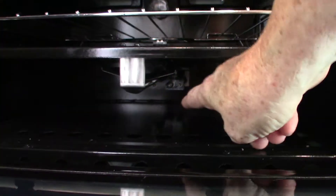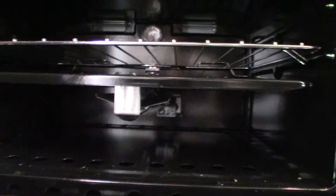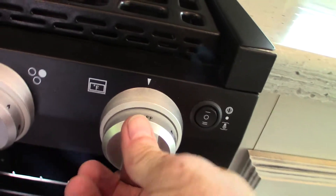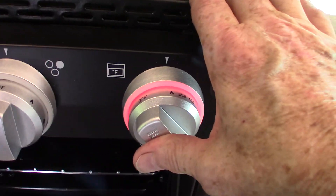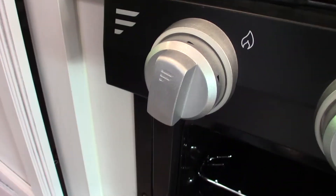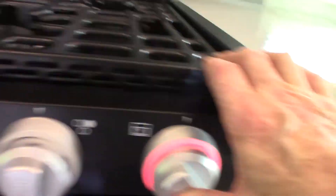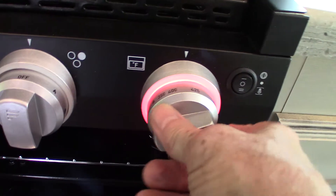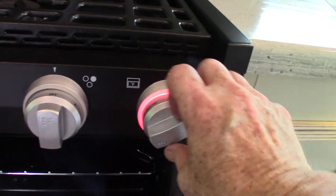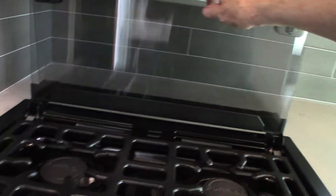The oven is a little different. All the way at the bottom, all the way to the back, is a pilot light. What you're going to do is go to the oven knob, go to the picture of the flame which means pilot light, and depress it. Keep it depressed during the whole lighting procedure. Then spark it by turning clockwise until you see the pilot light down there light. Once it lights, hold it for another ten seconds or so to heat up the thermocouple. Then go to whatever temperature you want — it cycles as an oven does. When you shut it off, the pilot light goes out, so you really have to light the pilot light each time you use the oven.